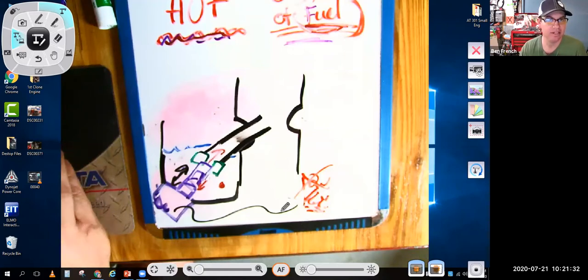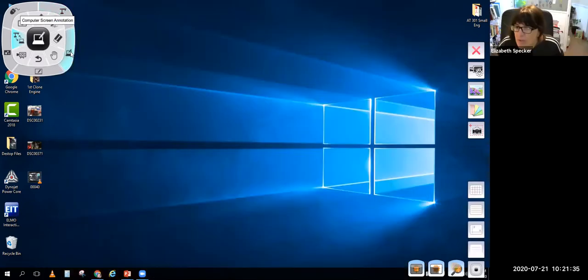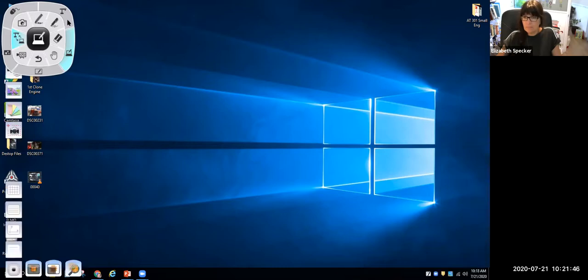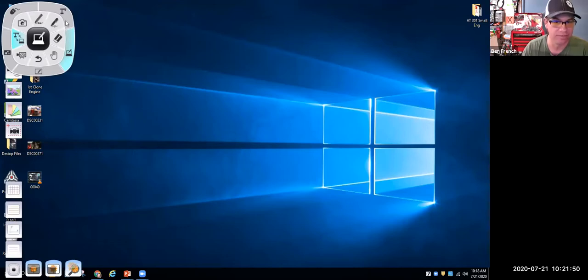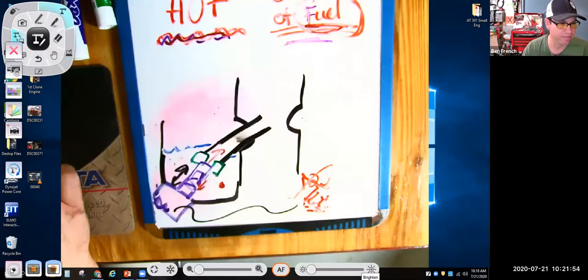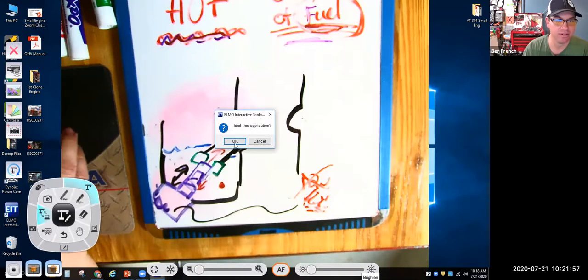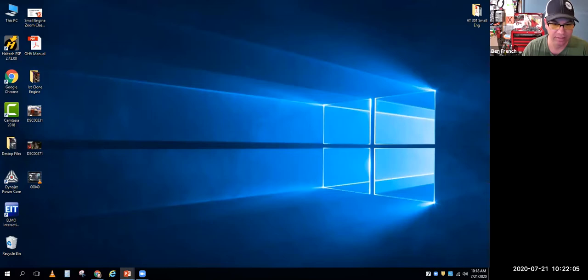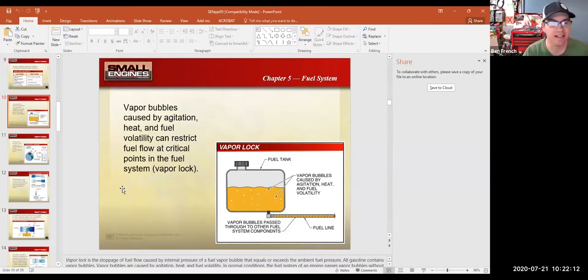All right, so I'm going to try to turn off my... there's a question in the chat. Oh, how does old fuel affect vapor lock? Old fuel makes vapor lock worse. You can make it real simple and just say that old fuel makes everything worse. There's my controls. Okay, I'll get a fresh screen share going again. Give me just a second. So yeah, old fuel can often make the vapor lock issue worse because a lot of the octane improvers will vaporize away, and then you end up with more issues.